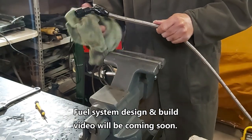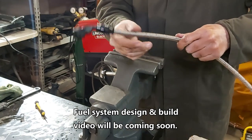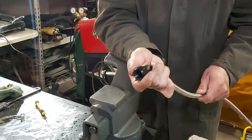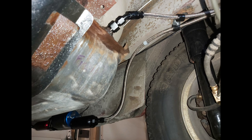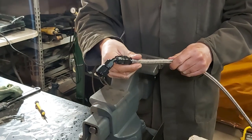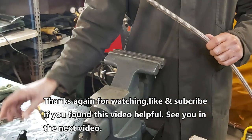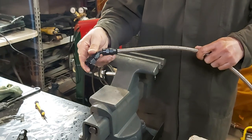So there we go — that's how you build a PTFE, poly tetrafluoroethylene, fitting and line. This will basically thread onto my fitting in the tank as our return line for the turbo LS. I'll put this in there, see where it comes out on the return line of the intake manifold, then cut this thing to the proper length and put the other fitting on the other end. Hopefully that was pretty clear and straightforward — how to build a PTFE fitting and fuel line.